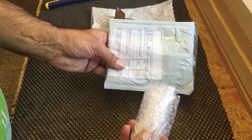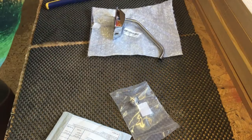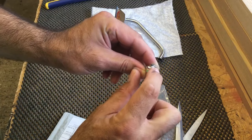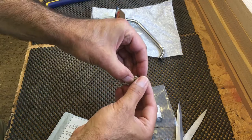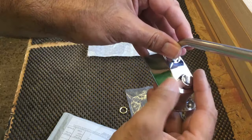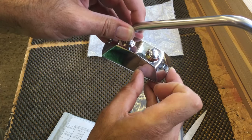A little parcel arrived from America this morning. I've managed to find this tiny little momentary push button — a little chrome one — which I think will be far better. It's waterproof and it will only turn the pump on when you press the button. It should be the same diameter as the one we've just taken out. That's much better — and when you need some water you just press the button, hold it, and when you release it the water stops.